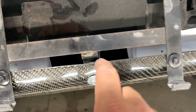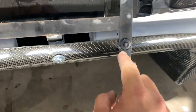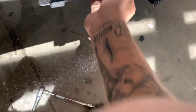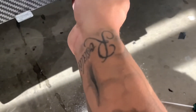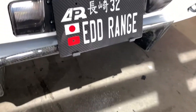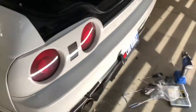I ended up making a U-shaped bracket that goes from the rear diffuser to the rear bumper. The side brackets had existing holes already — I drilled through them and installed push-down plastic clips that I actually bought a while ago and had sitting around. Everything just worked out perfect and now the diffuser is really solid — it doesn't move at all. Now let's test out the rear plate. It's going to fit perfect. The plate bracket itself is bolted onto the diffuser, so the plate won't move at all — which is a really good thing because it kept moving around before I had the diffuser on.